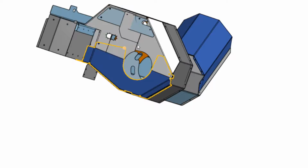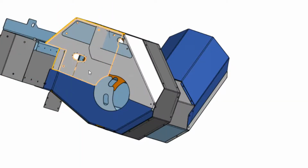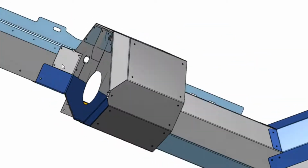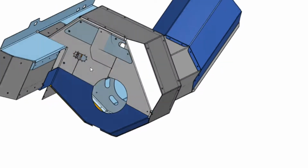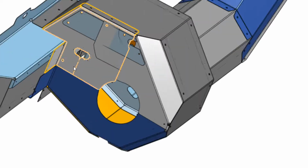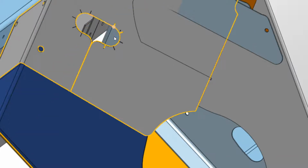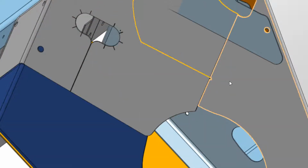This is the piece that I think in the video, when I'm doing the bench assembly of the tin, is the piece here. That's piece number 4, I believe, and that is the first one I'd probably work with. It has flanges on the top and the forward end, and then one flange that bends out to the left side here. It also has a cut in it from bottom up, and then this opening for your turbocharger oil pressure line. That line will angle through here and then come back to the turbocharger bearing.